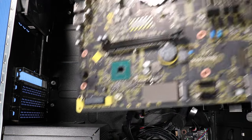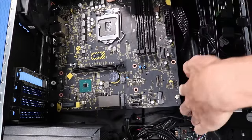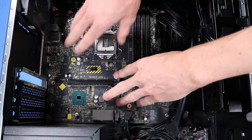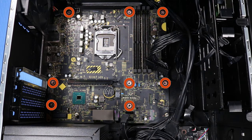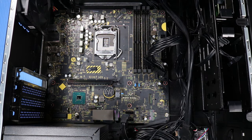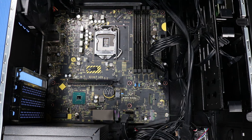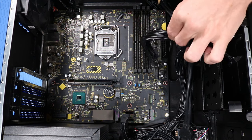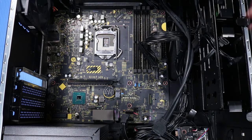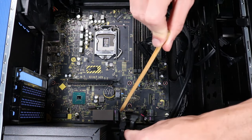Replacement: Grasp the motherboard on either side and guide the rear I/O connectors into the rear I/O panel while ensuring there are no cables trapped underneath the motherboard. Press down gently until the motherboard sits snugly in place. Replace the eight P1 Phillips-head screws that secure the motherboard to the side chassis. Reconnect the following cables to the motherboard: rear system fan cable, audio cable, 4-pin power cable, power button cable, 24-pin power cable, front I/O USB cable, 10-pin lighting cable, 2-pin power LED cable, and two SATA data cables.